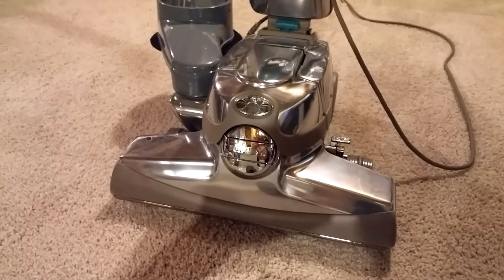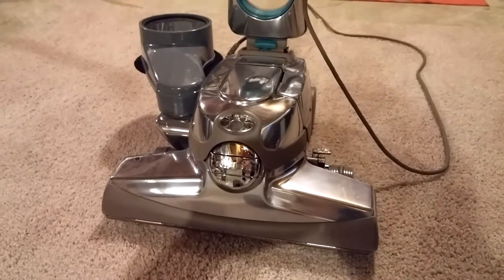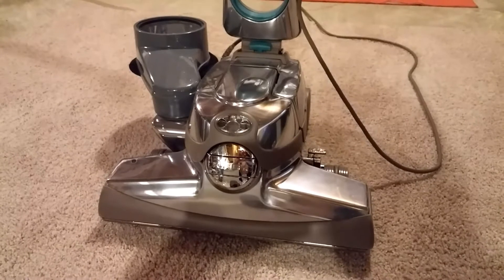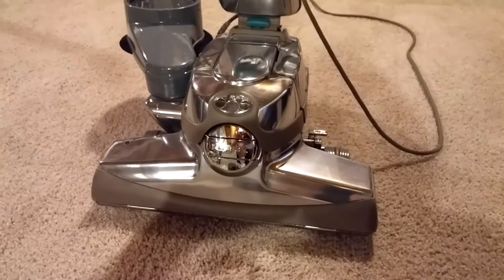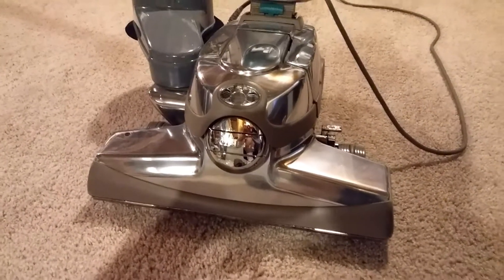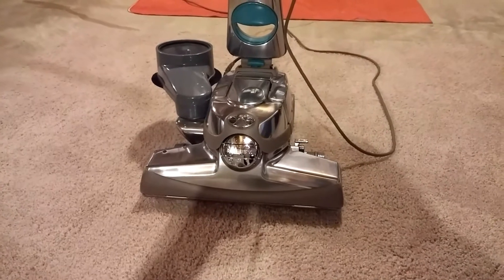So it's certainly something less than 32. Comparing it to the Dyson, it's probably going to be about half, but obviously the airflow is tremendously much more. So let's see — will high airflow combined with low water lift, and the brush roll down here with its oblique stiff bristles, make much of a difference compared to a Dyson DC65 or any other vacuum I'll repeat with this test?